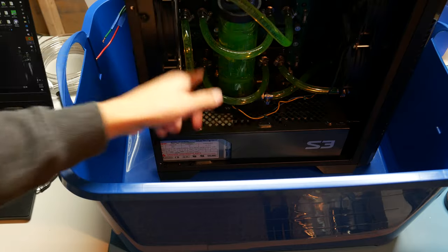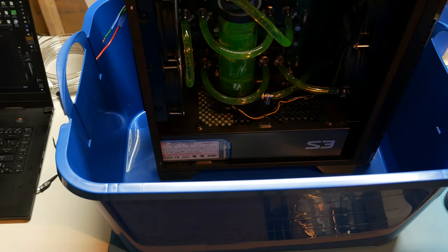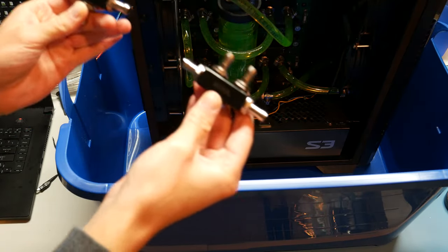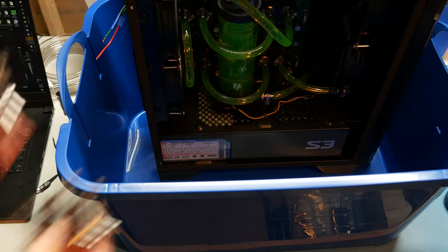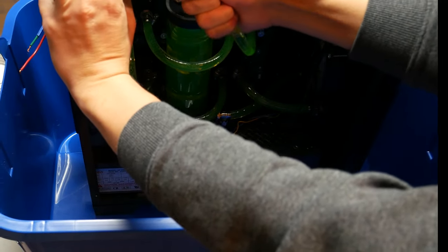Our water is getting hotter, hotter, hotter, hotter. This last block is getting the hottest water. It's gonna throttle first. And now we're gonna put them all in parallel, equal resistance, approximately equal division of water flow. Hopefully it works out. We're about to find out. All right, let's go. Let's just send it.